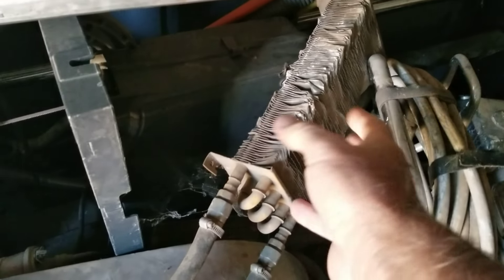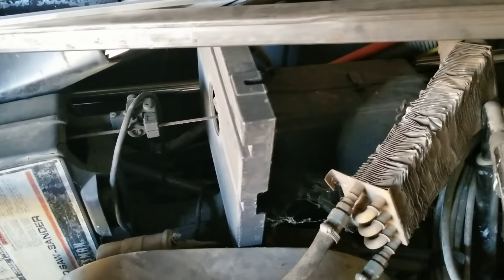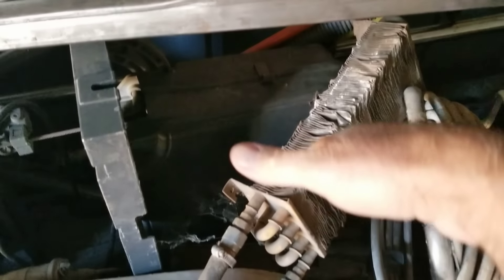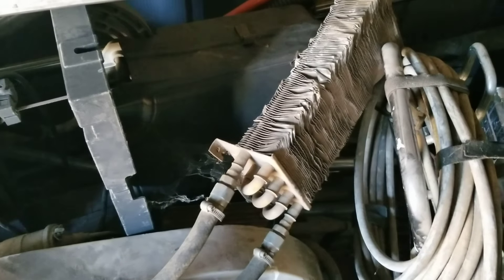Again, if you have an oil cooler, it should be mounted up over your transmission, or if you have a bus, you can put it on the side with a fan on it. Do not put it over the fan's intake hole — it will run hotter.